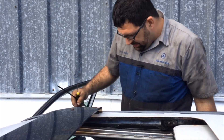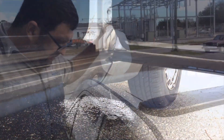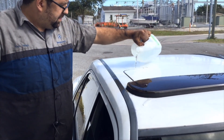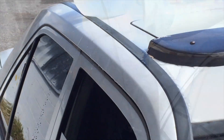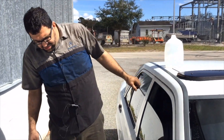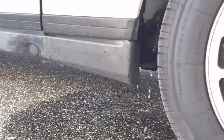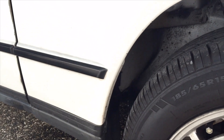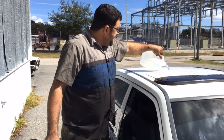Now you can see inside the door is a pillar. Make sure that we're draining. This is actually kind of a messy job. What you want to do is make sure that water is actually dripping down through these holes and making its way out of the sunroof drains, because the sunroof does not have a perfect seal around it. A big part of the sunroof working right is the fact that it actually has to drain.